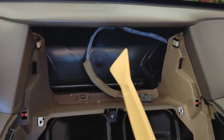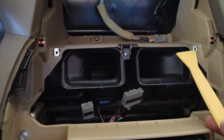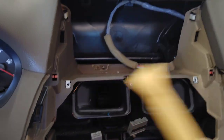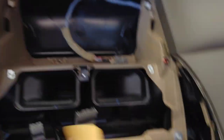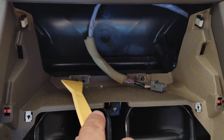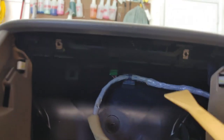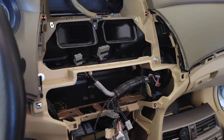From that point, the display was up here — there's a plastic trim ring held by two Phillips screws; once those come out the trim ring comes off. Then there was an 8mm bolt here, an 8mm bolt here, a Phillips screw here, and a Phillips screw there, and the whole digital display comes out. Like I said, I'm only five to ten minutes into this process.